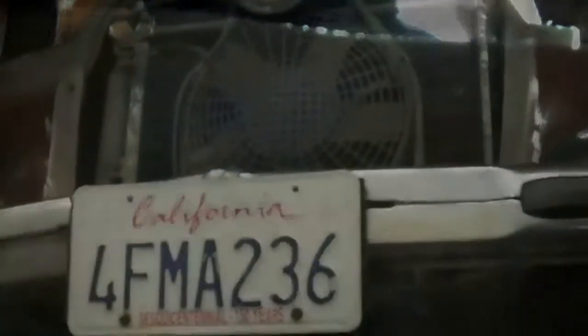This is the left side. The opposite side — it's kind of dark — but just know that it looks exactly like this left one, and the left one is in bad shape. I would recommend that you do change the motor mount soon, but if you don't notice anything like a rough idle, then you can wait on that. You don't have to change it right away.